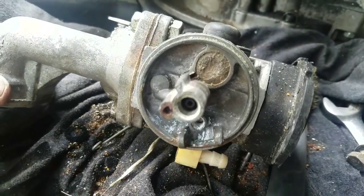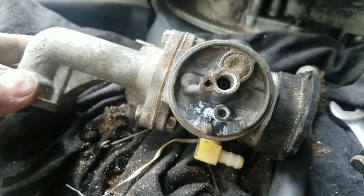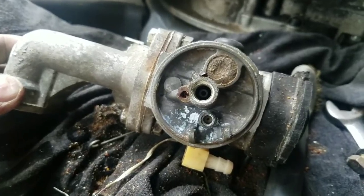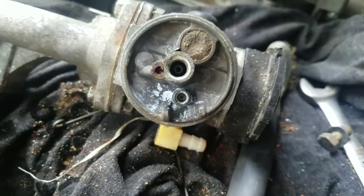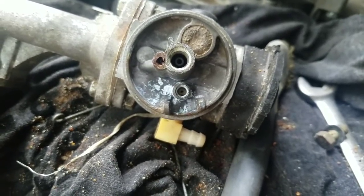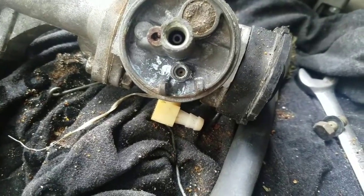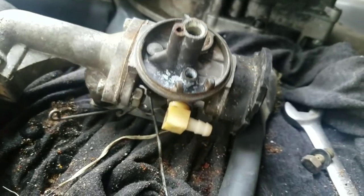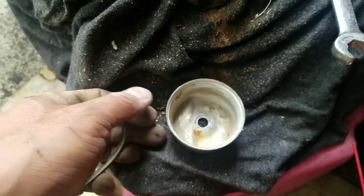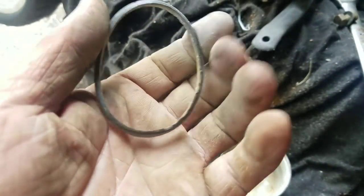I just started screwing with it and I'm making some progress. I just took a wire bristle brush and blew carb cleaner into the holes and now you can actually see the holes. The jet in the middle doesn't look too bad — fluid actually goes all the way through. And after cleaning it a little bit, the seat doesn't look bad either. I'm going to try cleaning this.